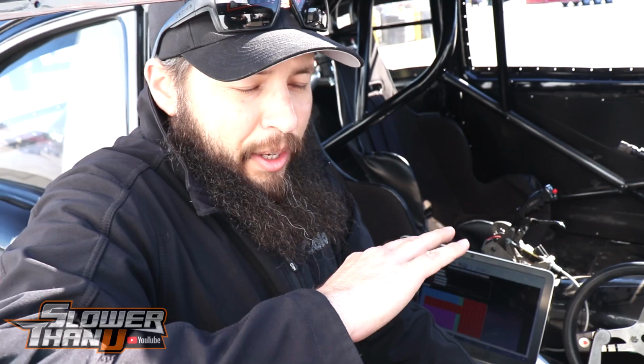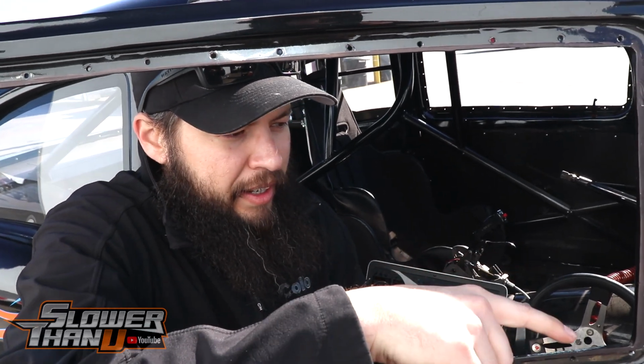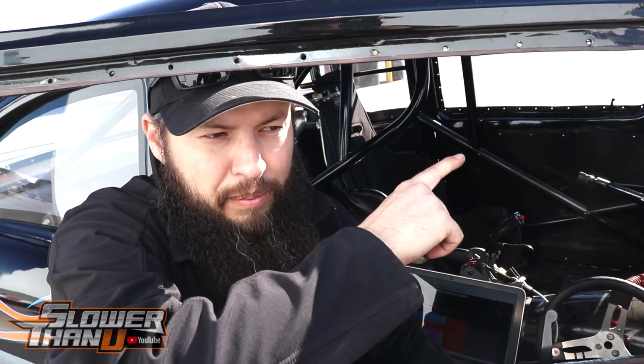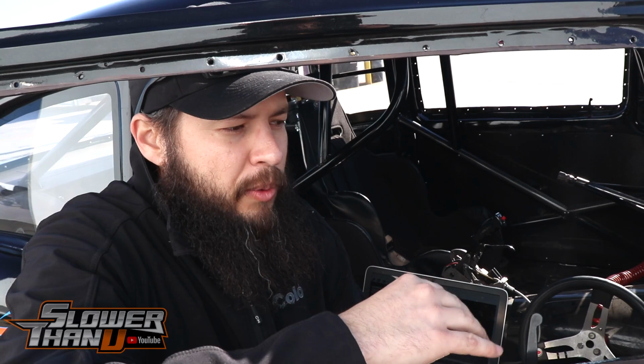Troy's car, he just recently got it. He wanted to come out and just give it a run at the same time. We were going to have our friend Crabtree drive it, but when we first pulled it out and started it up we noticed that it was smoking a lot from one of the banks, and Nick took the plugs out and realized one of them was cracked, so I'm hoping that was causing what was going on.